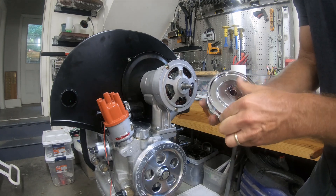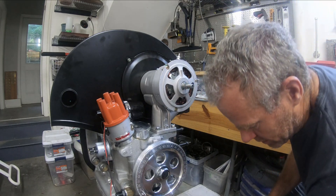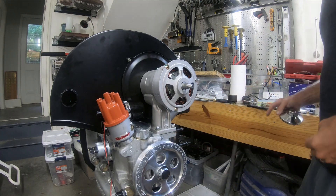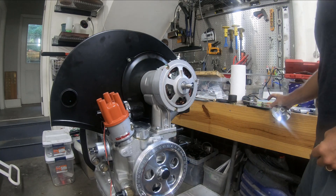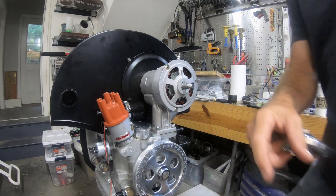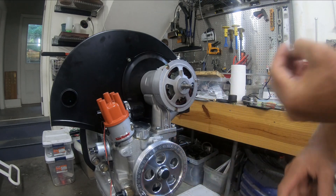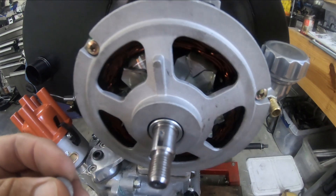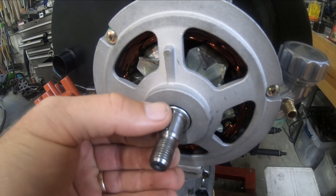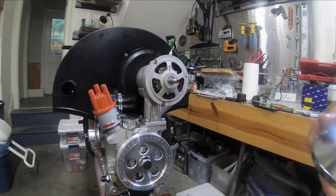What I'm going to do is get this thing on to the generator alternator and try to line it up with the fan belt so I can see how many shims I need. There are shims that can go up here and shims that can go down there. I'll start off by taking this little woodruff key — it's a tiny moon-shaped thing — and that goes right in here. This is always kind of tricky.